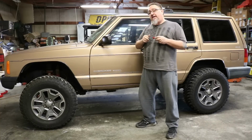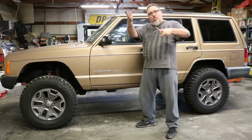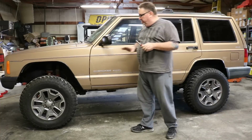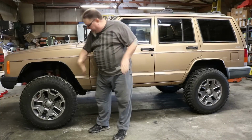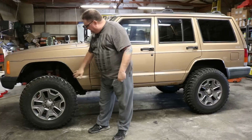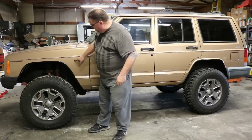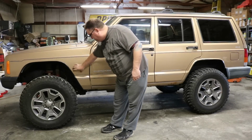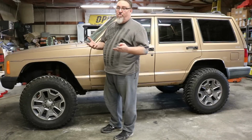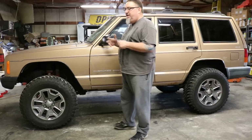A customer of mine sent me a link recently for some pipe insulation, but it was kind of a dark gray foam tube. And what we would do is just put that in this area here, and I'd take my sanding disc and shave the end however I needed to get it to fit in the bottom. And I'd make sure my fender well was really clean, and then I'd just press that tube in and run it up and over and butt it up against the washer bottle on this side and really create a seal in there. If you really wanted to, again, most guys don't do that, but if you really want the ultimate in soundproofing, waterproofing, if there is such a thing on one of these, you can do that.